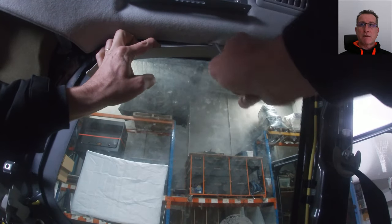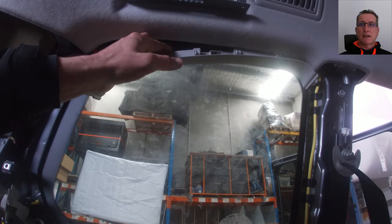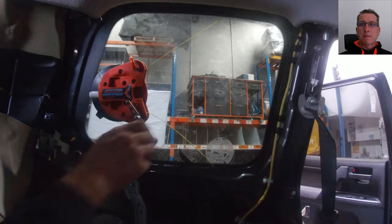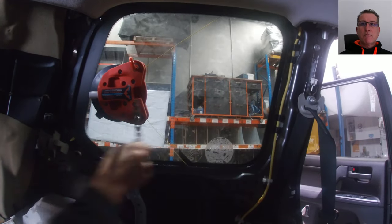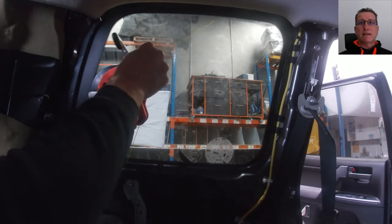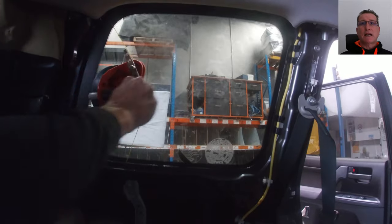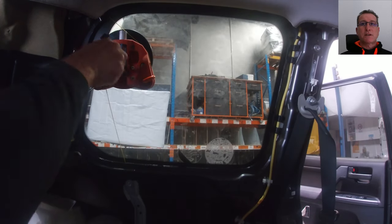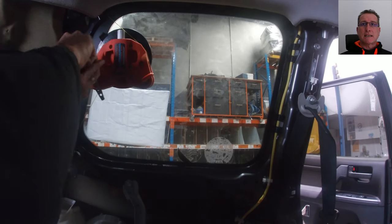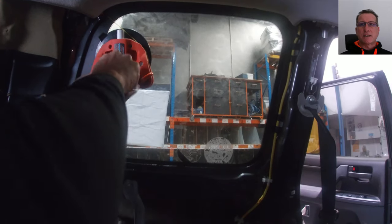Once all that's off we can remove the very top trim. This is an airbag deployment trim so it's got clips up there. You can remove them — we just cut them, they're no good anymore anyway. When removing these windows be really careful with Stanley knives because of the shape of the body underneath, it's really easy to do paintwork damage. Get in touch with a glazier that has one of these wonderful little tools — absolutely guaranteed no paint damage, nice and clean and easy. This is why we always encourage people to stick with glaziers for these jobs.